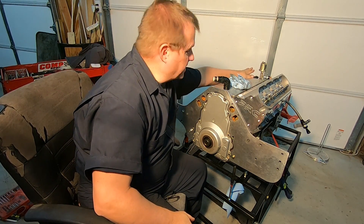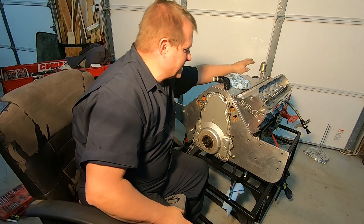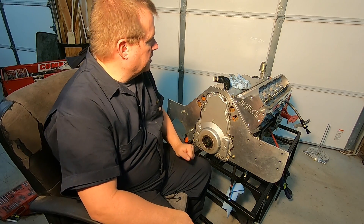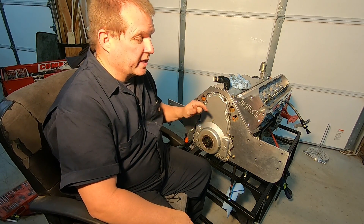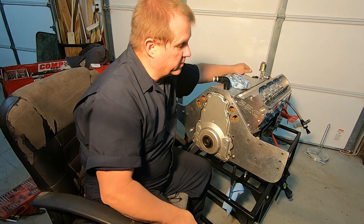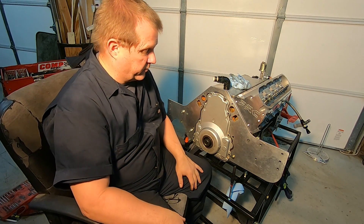What we're going to do is swap the rear cam sensor to the front cam sensor. It's not like taking the sensor out of here and putting it up here — that's not how this is going to work. Basically, when you swap the cam, what I'm talking about is where the cam pickup is going to be done. Instead of having the pickup back here for the computer, the pickup is going to be done here on the front of the cover.